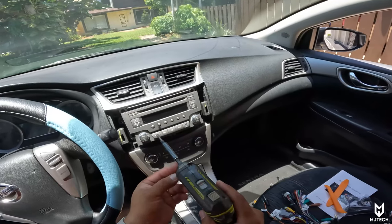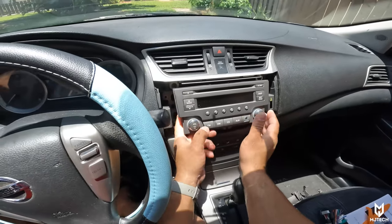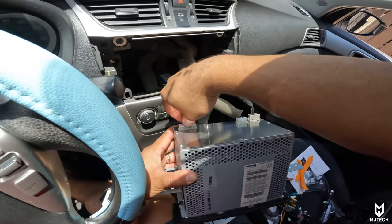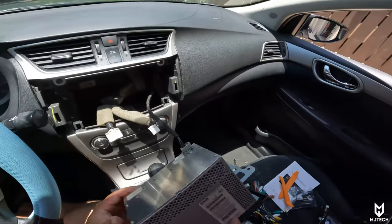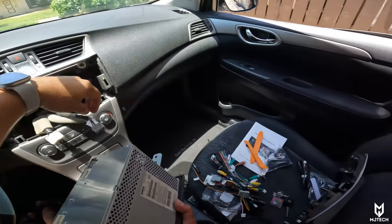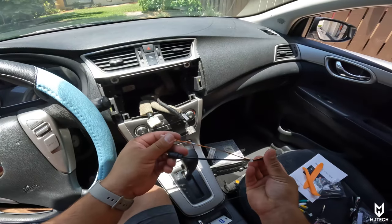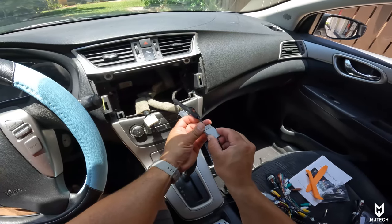You might also need a magnet. After removing those four Phillips screws, there's a little hook — you have to lift the radio and then pull it out. Then simply undo a couple of harnesses from the back. It seems like a simple radio. I do notice the FM antenna is a little bit different — they did include an adapter for this. This is the antenna auto adapter and apparently we have to connect this as well.